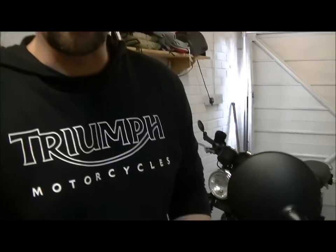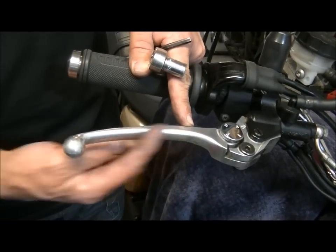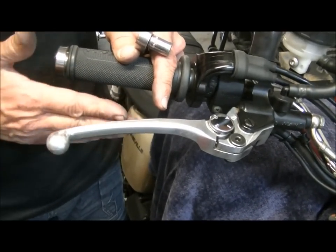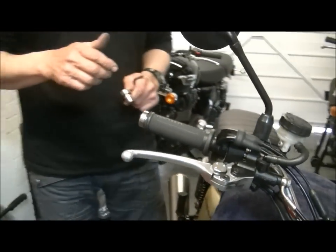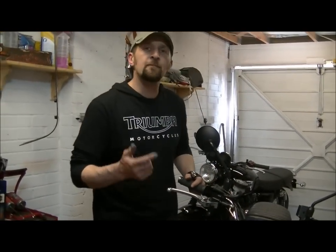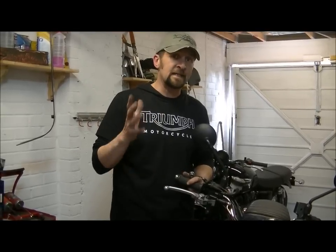Penny has hands like the borrowers. And to get this further in, a few people have said in the past that they can heat this and bend it in. I can't recommend anything on your bike less than heating this cast alloy lever and bending it, because it is a cast alloy lever — it just isn't malleable enough to bend, it isn't made of the right material and it will snap. If it doesn't snap when you're trying to bend it, it will snap when you try and use it. Heating any metal up and cooling it down again is going to have an effect on it — the process of annealing and hardening — and cast alloy just doesn't lend itself to being heated.